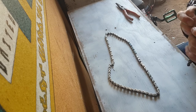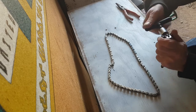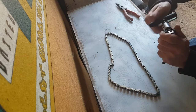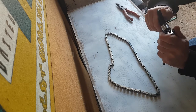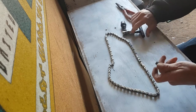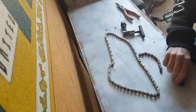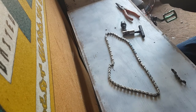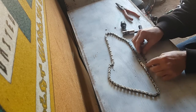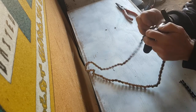Now make sure you always get the right one, otherwise you could be in a lot of trouble. Break that one open now, making sure you don't push that pin all the way through. Hopefully the chain will just pop apart. Put the pieces to the side — you never know when you need them. Three links, just what we need.